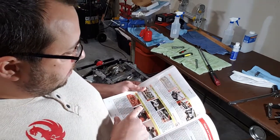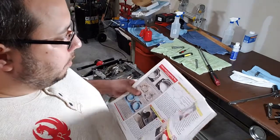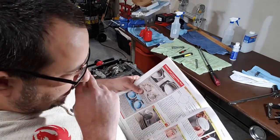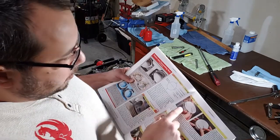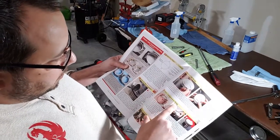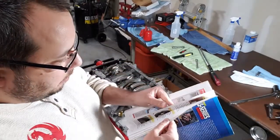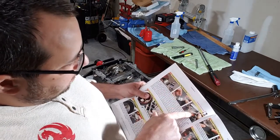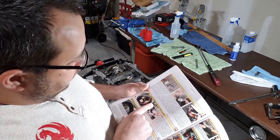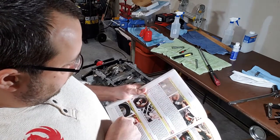We assembled the pistons to the connecting rods. We determined the piston ring clocking. We installed the oil support ring. We installed the oil rings. We installed the compression rings. We went ahead and got the crank turning tool going. We installed connecting rod bearings. We turned the engine on its stand. Okay, we adjusted and prepared the ring compressor.